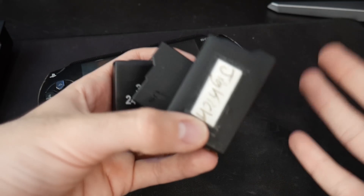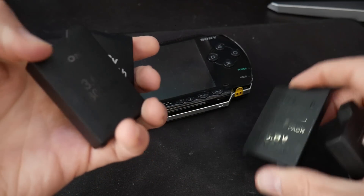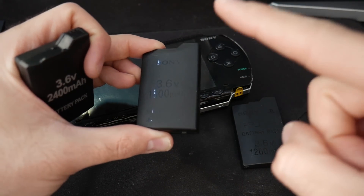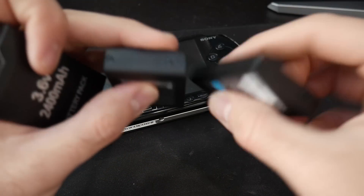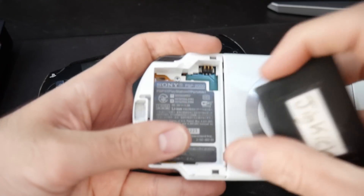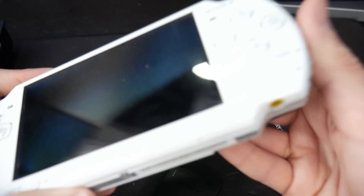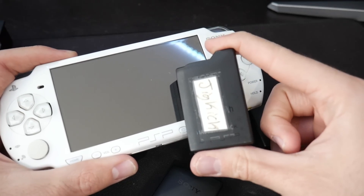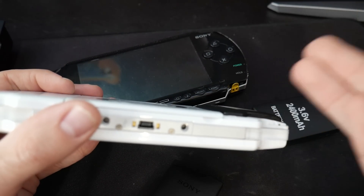As for the actual battery recommendation: the one you should use is a fat, original OEM Sony battery - a fat battery for the PSP 1000. If you're worried it's too big for the 2000, it still works - this is a slim battery and it's quite literally slim, however if you ever need to use this in a slim console you just pop it in the back, it still plugs in, and look at that - the console turned on all by itself. That means it is a Pandora's battery. The only downside is it's so big you cannot use the battery cover.